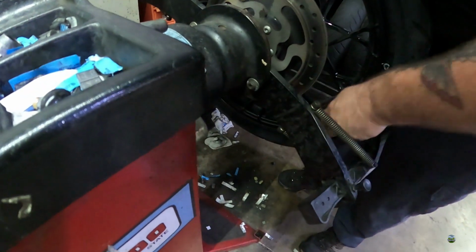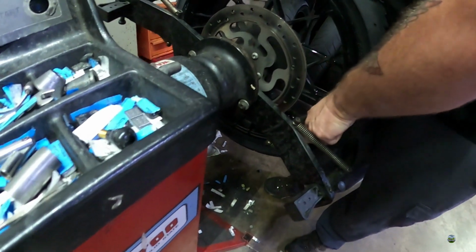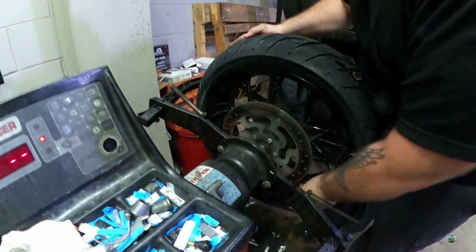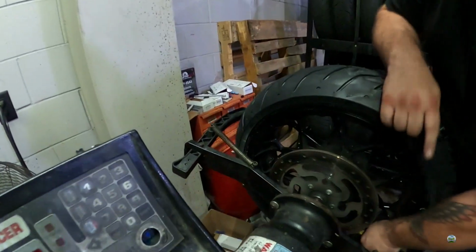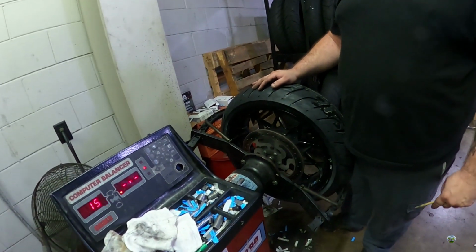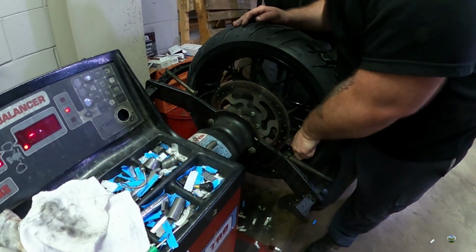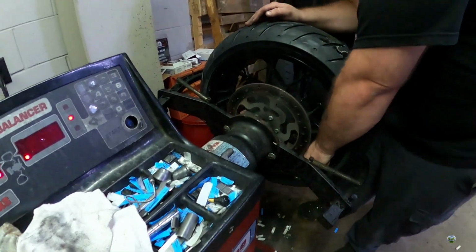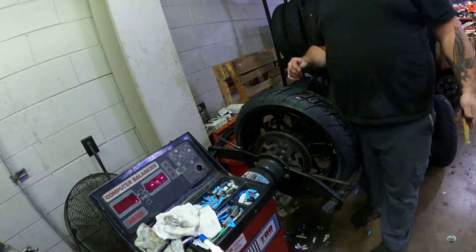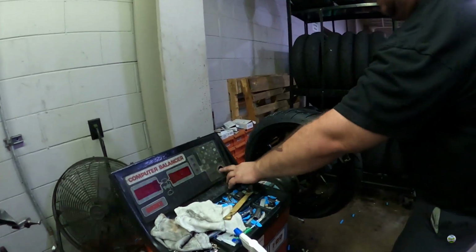We're not supposed to put more than 3.5 ounces on a wheel. So if I spin this around and it says 4 ounces, I'll swap that balance dot over to the 180 and then re-go. And if it's still over 4.5, then I turn the tire back into parts so we can get a different one. And they'll warranty out the tire for failure to balance. Wow. That's a perk of being at a big Harley store too, is we have the ability to just swap that out. That's what I'm talking about, versus waiting on something.